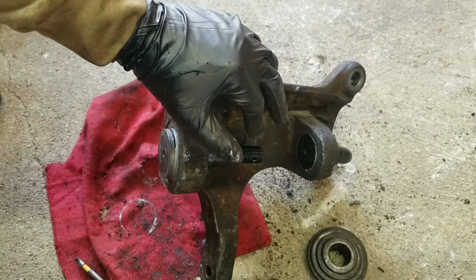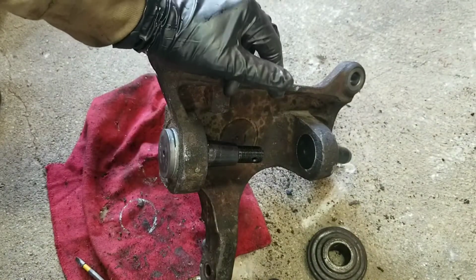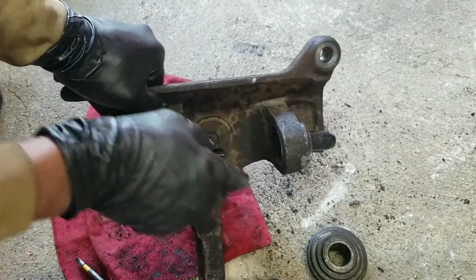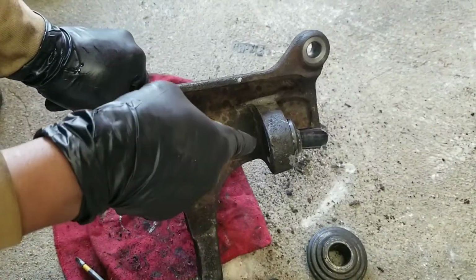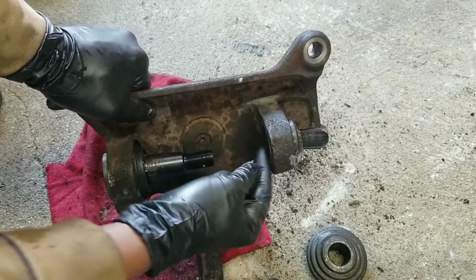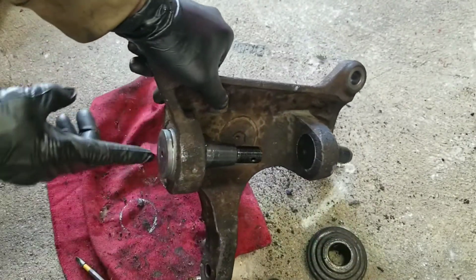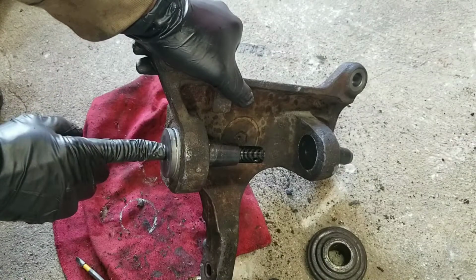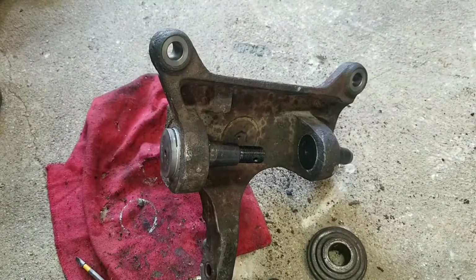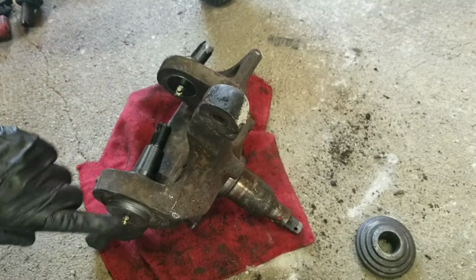There's one that's like a 90 degree grease fitting. That one goes up top, so that way when you're greasing it, you just snap the grease gun directly onto it and not have to come from the bottom. So it's a 90 degree, comes down and out. You just go straight into it. The bottom one is generally just straight. You go right in. So I put those two in. The clip on. So I got the fittings on.